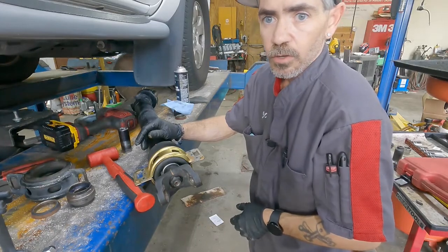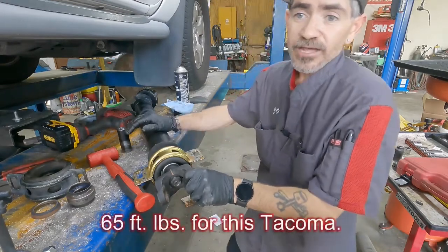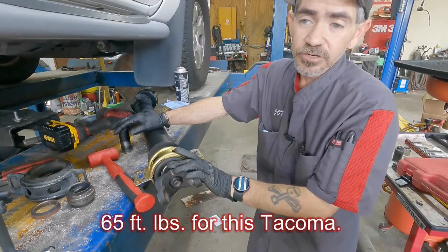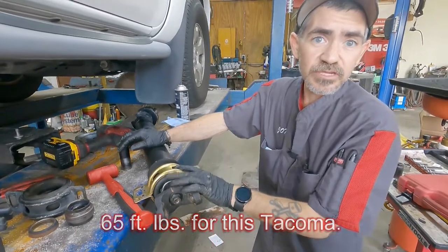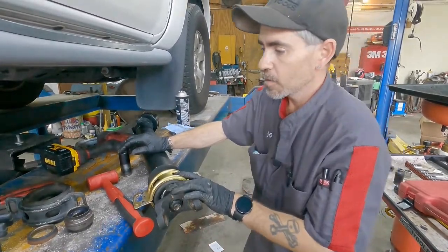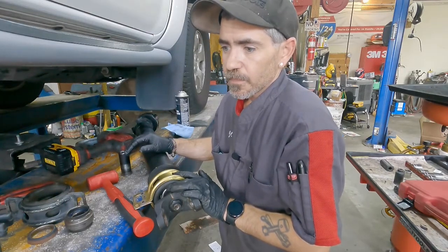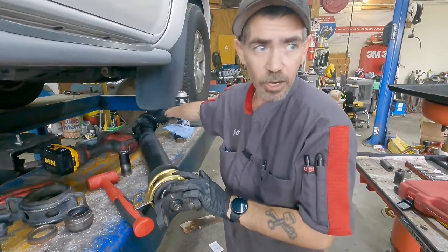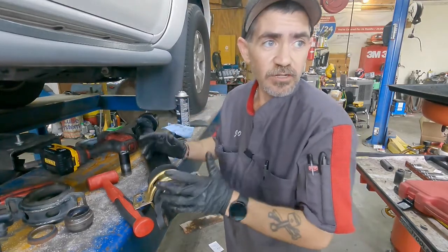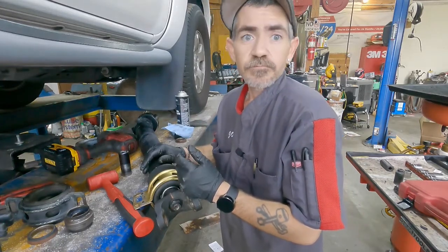Torque: what should you torque the final bolts — from the drive shaft to the rear end? I don't know the exact torque, but it does need to be tight. You don't want to over-tighten it — the best thing is to look up the exact specs online. We'll get that information and post it in the description. John, is there anything else the watchers should know? If you're getting this deep, replace the U-joint. Also inspect your output shaft seal on your transmission — if you've got a leak and the drive shaft is already out, that's a good time to replace it. You're just looking for any kind of splatter grease. On ours it looked pretty clean.